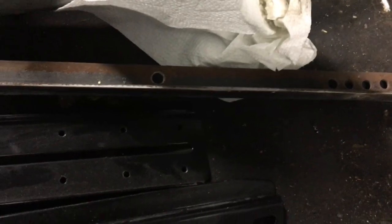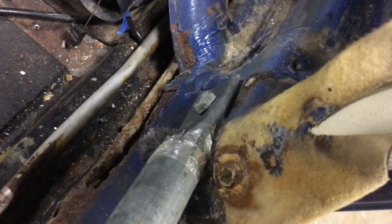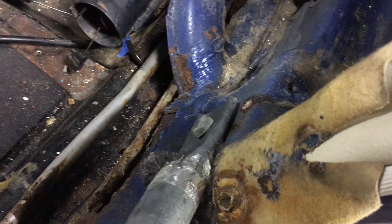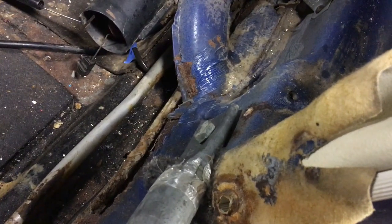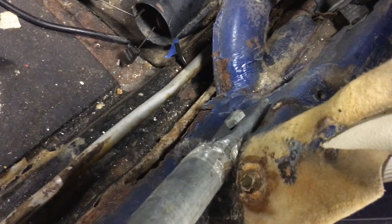here, but first I'm gonna put in some angle iron on the tube so we have a flat surface rather than a round surface. And as you can see, I smooshed that one down with a sledgehammer. And then I'm gonna weld around there too. I'm not just gonna keep it bolted. I'm gonna weld around it as well because, you know, the bolts easily could just turn and I don't want that to happen.